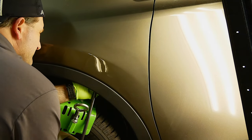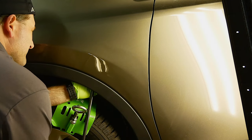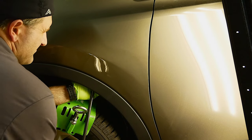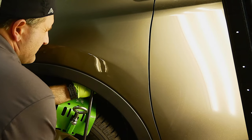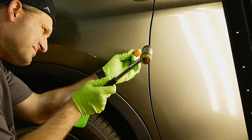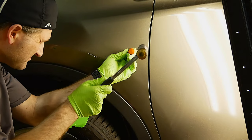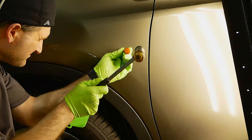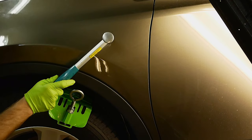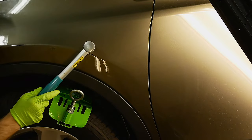Now that I've got most of the major crown work done, with a little bit more still left to do, I want to get in and push behind this metal, structure that body line, and bring up all those low spots. This process is going to take quite a bit of time. I'm going to have to go back and forth with pushing, knocking down, using the knockdown and hammers, and a variety of different tips — pushing from behind with softer tips for the bulk damage, then switching to sharper, smaller tips to fine-tune and bring back the detail in the panel.